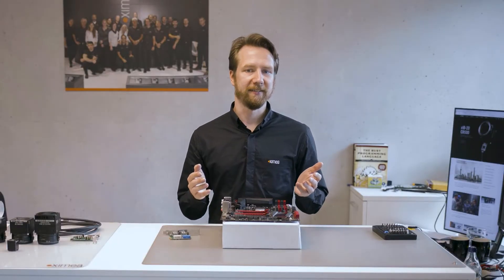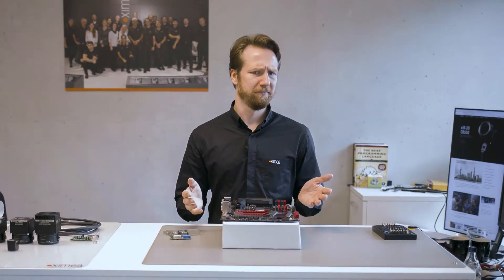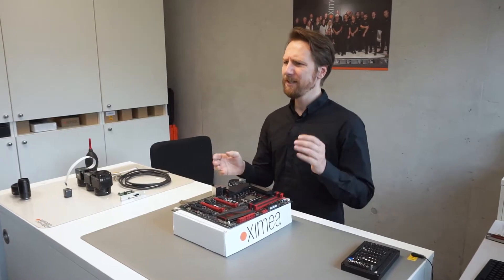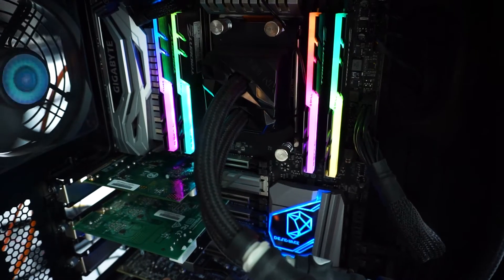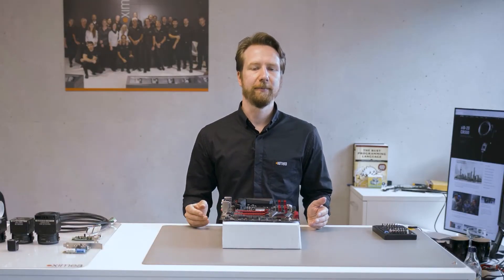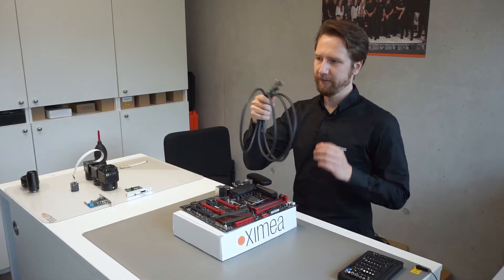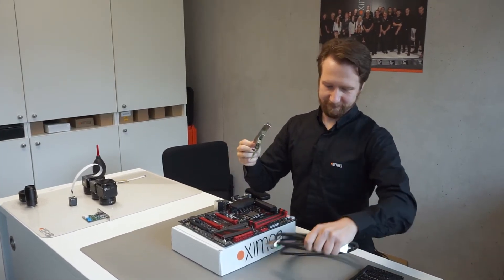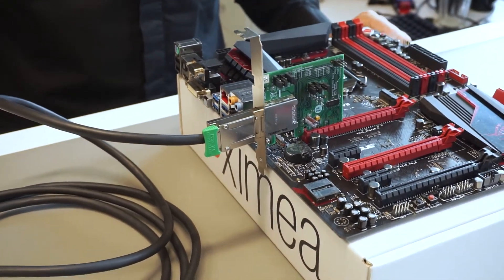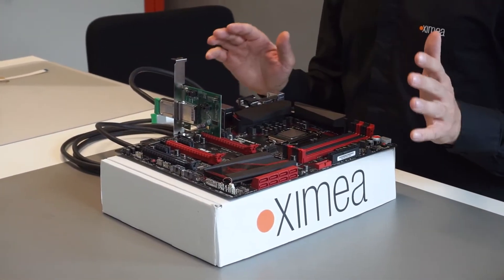So that is PCIe. But what does that have to do with cameras? You can't just put a camera in a PCIe slot — it would just film the inside of your PC. So what you need is a way to extend these PCIe slots to connect the camera at some distance. For this you will need a cable like this one and an adapter like this one. All this adapter does is connect four PCIe lanes from the slot to a cable that also has four lanes. There is no additional logic on it, and from the software perspective it looks completely transparent and does not need any drivers.